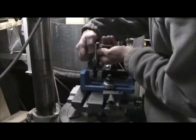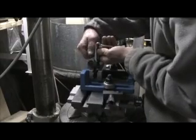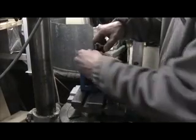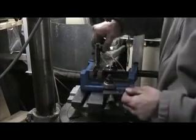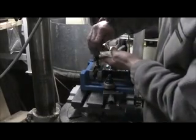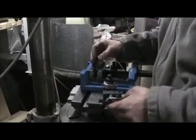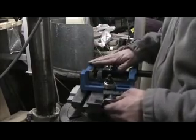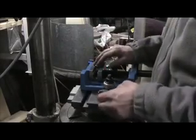This allows you to bypass the damage, expand it fairly tight — don't overdo it because it is fairly delicate, it's just sheet metal. Back it out. Two or three passes usually does it, and then it allows you to pass a tap through if necessary to really clean it up and make sure it's good.